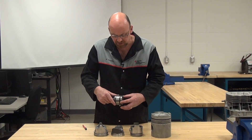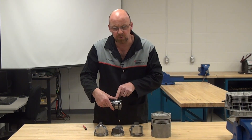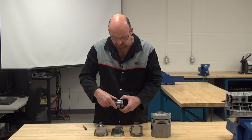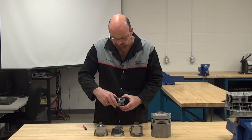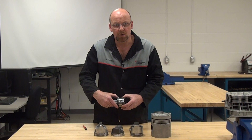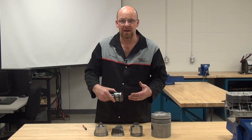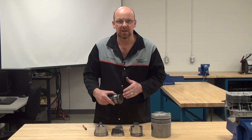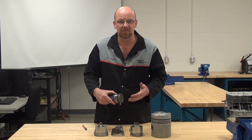This is kind of an interesting one. It uses three compression rings — two on the top and one on the bottom — and then it also uses two scraper style oil control rings, because we really don't want to have any additional oil being displaced into the air tanks on a truck.